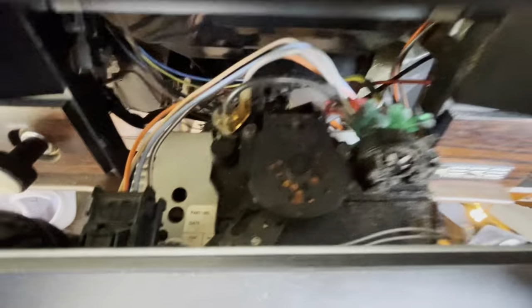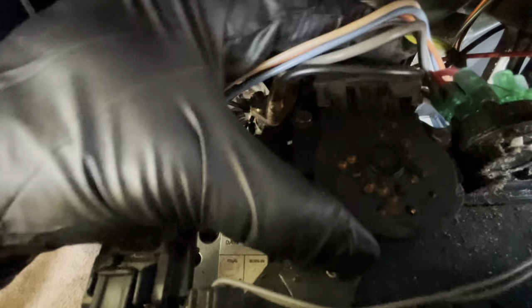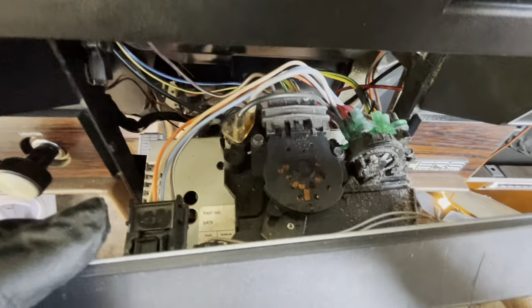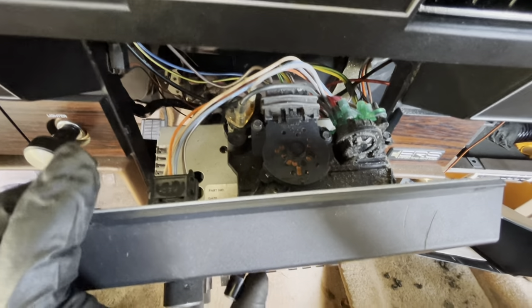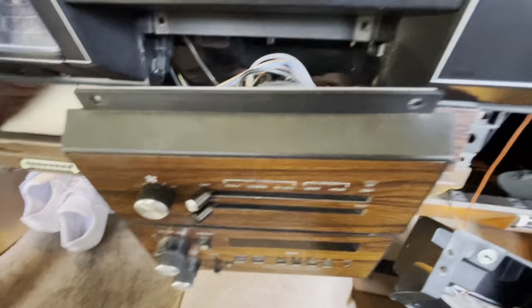I got the new one on, about to plug it up. It's in the socket — that's the switch. Before y'all put everything back together, test it. Start your car up, turn your AC on, see if it comes on. It should.